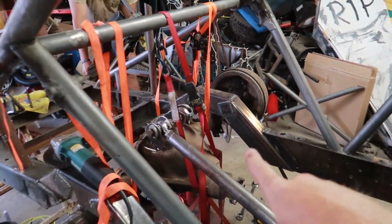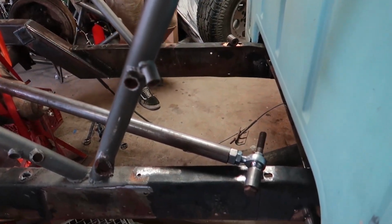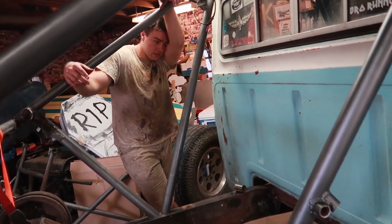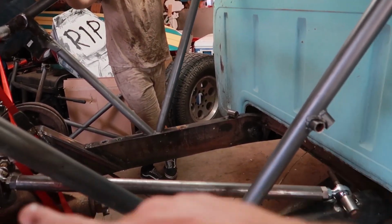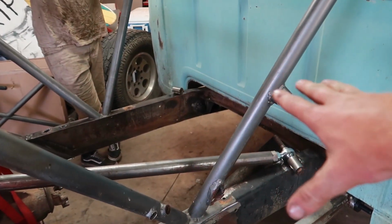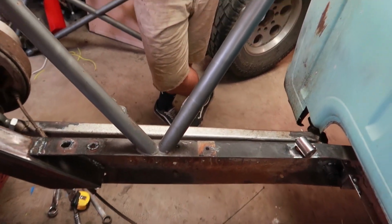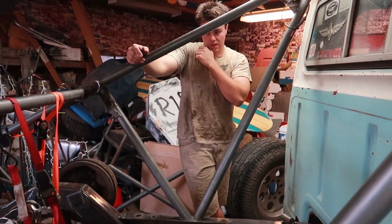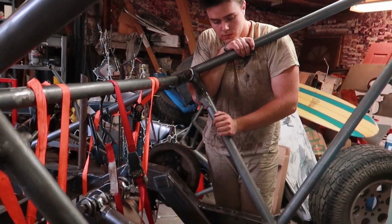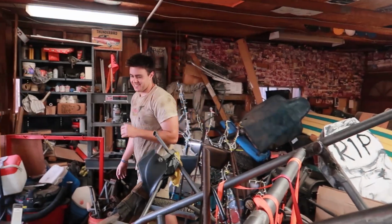But anyways, right now, what are we doing? Are we welding this one? This one we're on top? Tacking those on and then tacking this in. That's roughly the length. Cut a piece of DOM for that, tack those on and then cycle this thing. Get the other one done, so we'll have all four. Everything's on, it just needs to get tacked. I need to get another piece cut, and then adjust these a little bit, and we can cycle this thing. We're going to get this welded up and see if Franklin designed it correctly, see if it does what it's supposed to do.